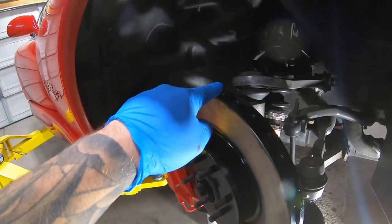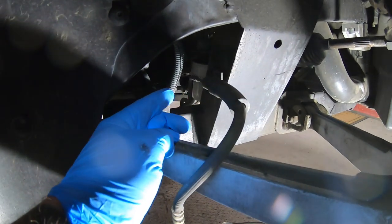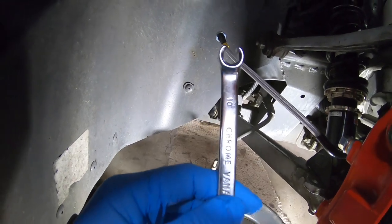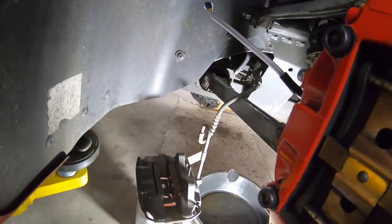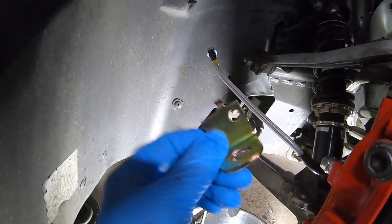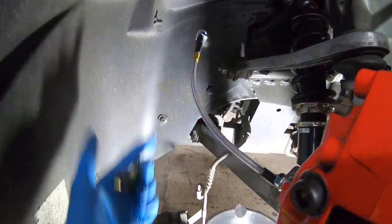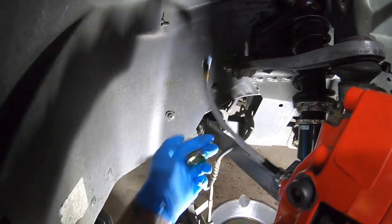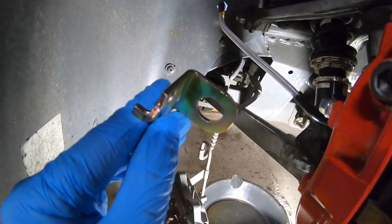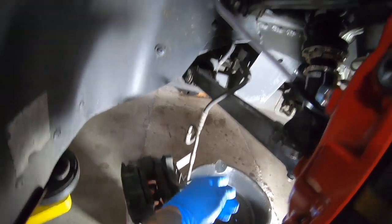All hardware is tight. We connect the brake line over there — it's mounted to the frame with a 13mm bolt, and we'll use a 10mm line wrench to remove the hard line, then connect the new one. One nice thing about getting lines dedicated to this vehicle is that the kit includes the replacement bracket tree. If you just got generic stainless or braided lines, you'd be left without that support bracket, so I'd recommend the Viper-dedicated kit for front and rear.